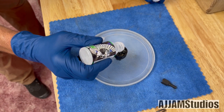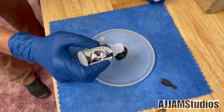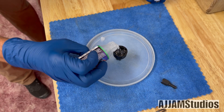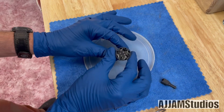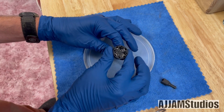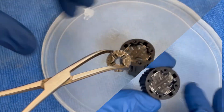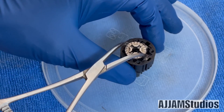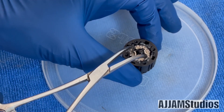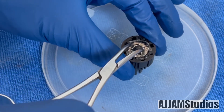Now we can go ahead and top it up with oil. Be real careful — you only want the oil to the top of the gears. You don't want too much because it'll overspill and you'll have pressure inside the housing. It's just up on the gears — that's where you want that. Be real careful not to overfill. Now go ahead and put the outer drive gear on this side, push it down in there, and work it in a little bit. Make sure everything seats good.